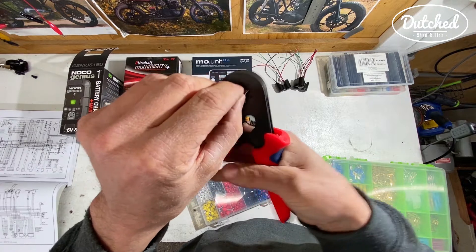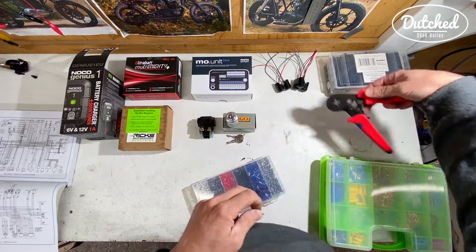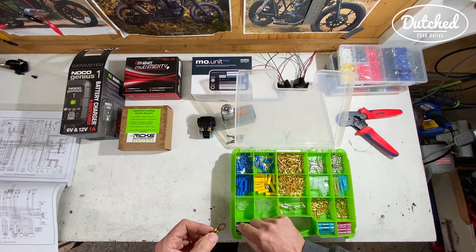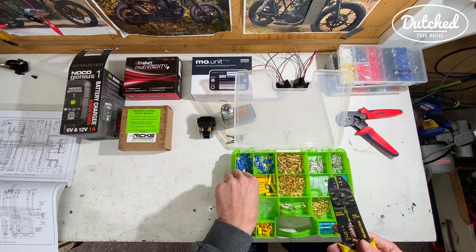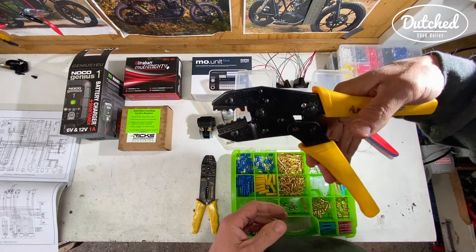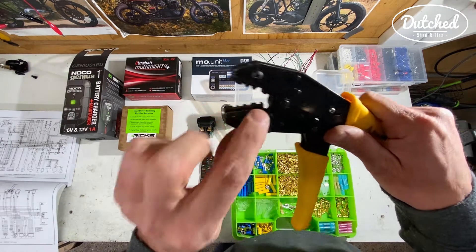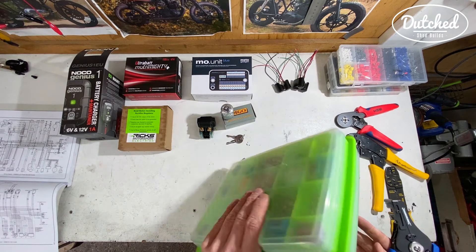Once you push it in and crimp it up, as you can see. I got the crimping tool at HPM. There are other types of connectors too — bullet connectors and big ones for starter cables. They come big and small and you also need tools to crimp these down. There are special tools with replaceable bits as well. They came with different mouthpieces so you can change that.